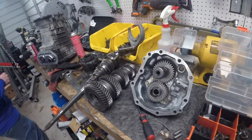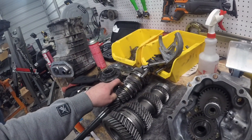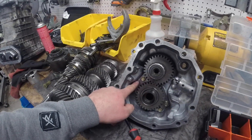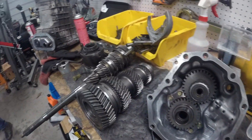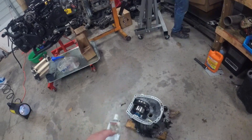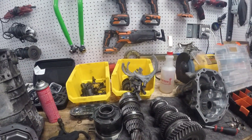It's time to put the gears together. Like I mentioned in the last video, we did a JDM five and six short ratio, carbon synchros on four, five, and six. We replaced fourth gear and the slider assembly was kind of mangled up. This is the bearing that was all chewed up — the gear was pressed off, the new bearing pressed on and back together, bolted in. We just cleaned the transmission up, so we're going to use Three Bond 1215 for transmissions to seal it up, then put the mid plate on, and after that assemble the gears with the shift forks and stack it in.